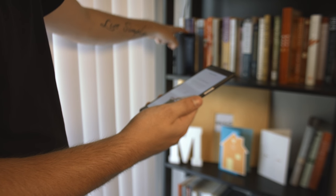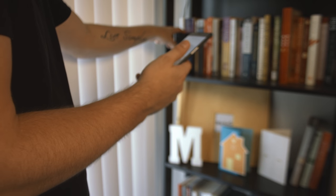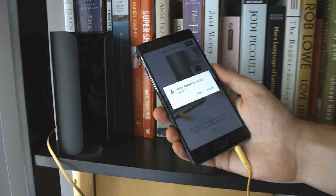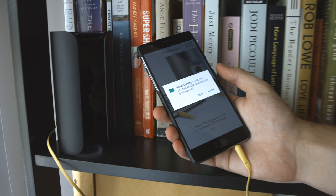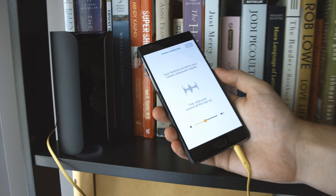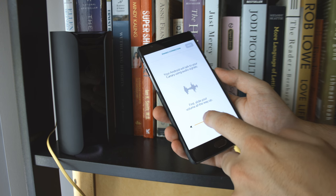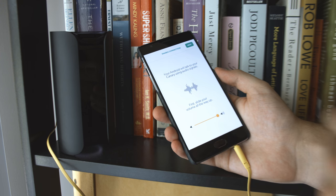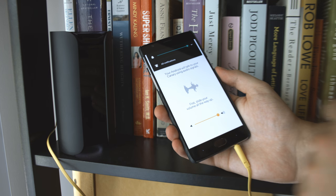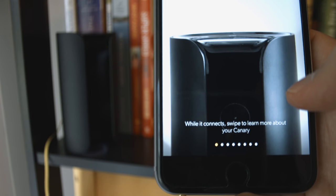I was curious if there was a newer model out, even though I just bought this thing brand new from the Apple Store. The second way to pair is the auxiliary cord, one end in the phone and the other in the Canary. It plays audio frequencies to pair, which is pretty interesting. Then it ran into a network error — I had only had the 5 GHz enabled on my network, and this thing only operates on 2.4 GHz, so I had to go into my network settings and enable that.